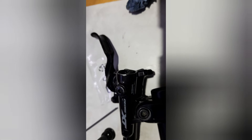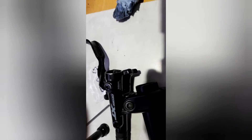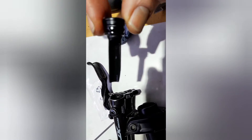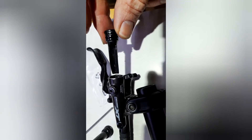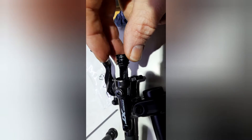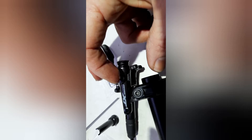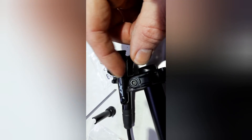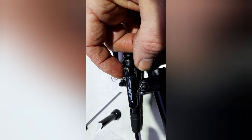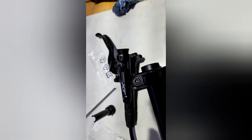You can see the bleed port on the top - just orientating it. I've popped the bladder over the top of the end cap with the two sloped bits matched to each other. Now I'm going to slide this in - the open cup end is at the bottom, orientated furthest away from the bleed port. That's the correct orientation so it's most protected and doesn't rub against the bottom of the screw in the chamber. Now I'm just going to squarely push this back inside.